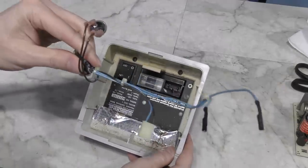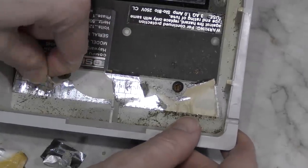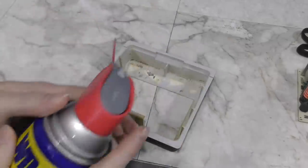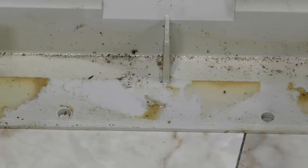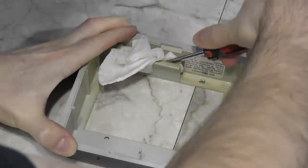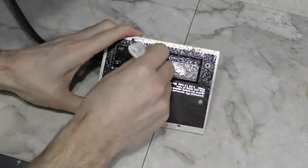Next I wanted to turn my attention to this power panel. I needed to remove the plastic bezel — there appeared to be just two screws, but I realized there were two more under this old crusty sticker. Since I didn't know what the purpose of the sticker was, I just decided to remove it completely. With the two parts separated it would be much easier to clean. I sprayed some WD-40 on there and let it sit for a few minutes, which helped a lot. After that, I rinsed the whole thing off in the sink and used a scrub brush to get some of the more stubborn gunk. Drying it off, I can already tell it looks 100 times better. Sure, it needs some retrobrite, but it looks much better already. This metal piece here was gross too, so I just sprayed it down with some Windex and it cleaned right up.